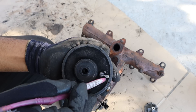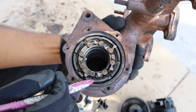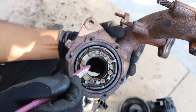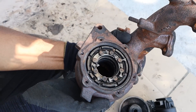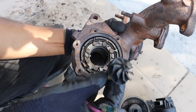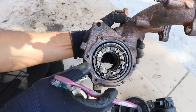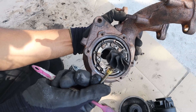The position of that ring is controlled by the pintle, which in turn is controlled by the ECU through the linear actuator. The pintle locks into one of these holes, and all of the vanes would normally be locked into grooves, moving back and forth to control the vane angle and thus how much air is being diverted directly to the catalytic converter versus how much actually goes through the turbine. This controls the speed and how much boost you need. By using a variable geometry turbo you're controlling the aspect ratio — the amount of air that goes in compared to the amount that comes out — and you can vary that based on RPM: at lower RPM you get a faster spool of the turbine wheel, and at higher RPM you allow a lot of air to flow through so it doesn't become a restriction.